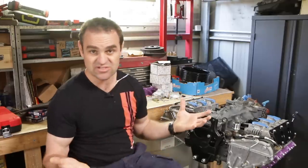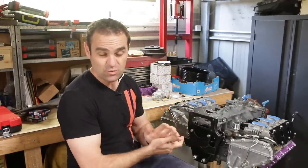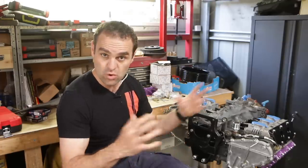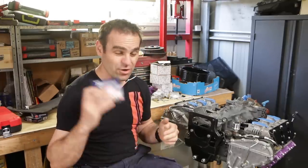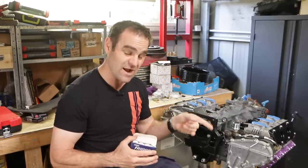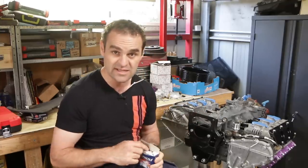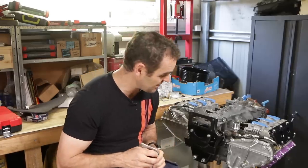In my case I can't go a CDI box because I am going complete EFI, which means no distributor — I'm getting rid of the distributor, so it's obviously more controllable. Before I get deep into this engine, I went and ordered some spark plugs through Super Cheap and they've sorted me out with some iridium plugs. Let's go through and install the plugs. There's one in particular that's going to be a little bit more troublesome, but let's get them all in there and then we can move forward.